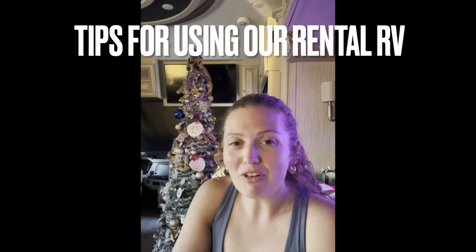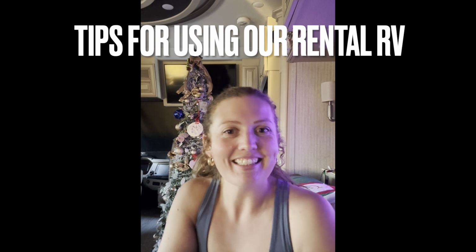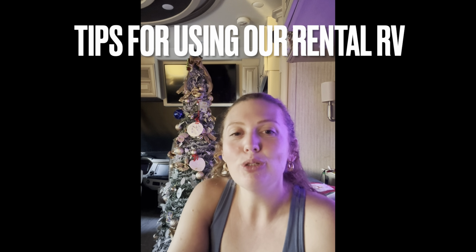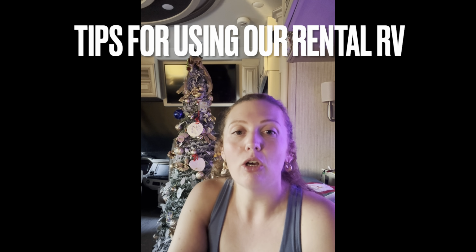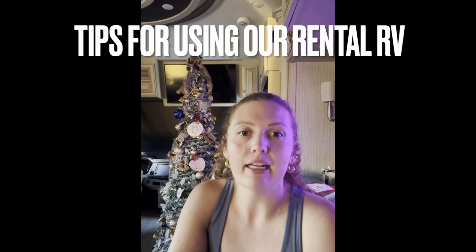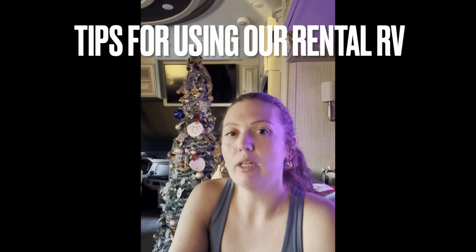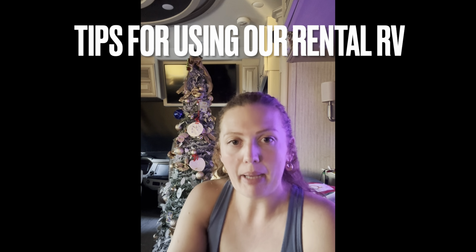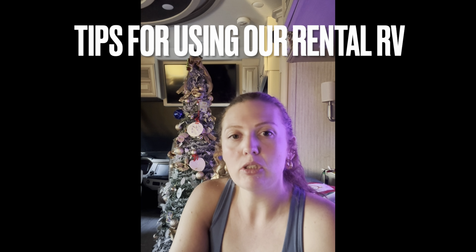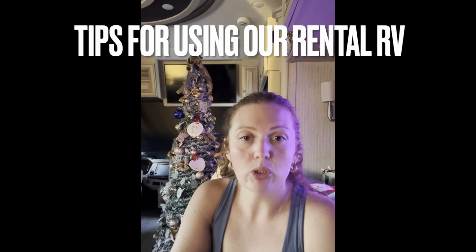So I think that covers a little bit of everything, but lastly, as I forgot, you do want to make sure you know how to pack up and leave. So the biggest thing is, whenever people are doing inside and outside, you do not want to unhook from power too early. You can unhook from water, do your sewage, all that stuff, but leave the power on, because you need that to pull the slides in. That's the easiest way to do it.